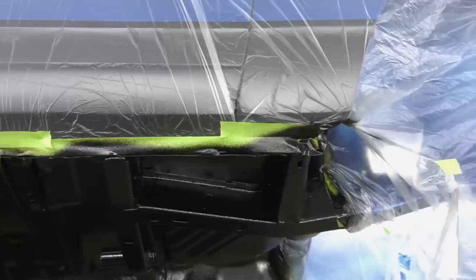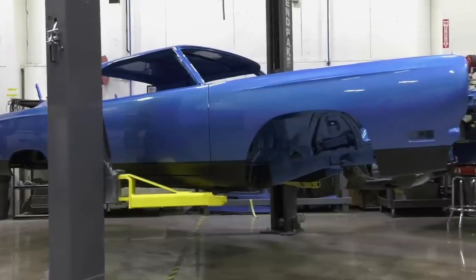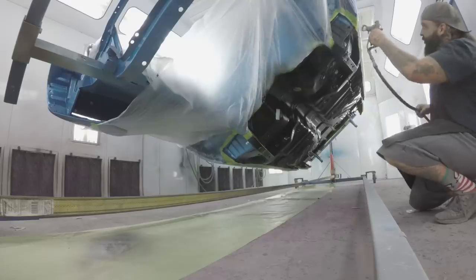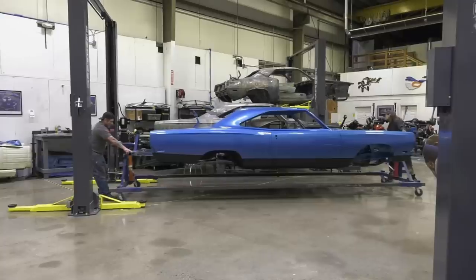The undercoating process we do on 90% of our cars depends on what the fender tag says. Once the car is completely buffed and all the paint work is done, take it out, pressure wash it, give it a really good bath, get all that compound out — because if it's left on there it gets hard as a rock. Get the car cleaned, bring it back into the paint booth, mask the whole car, and at that point I'll undercoat it. We have a great system — very easy, low maintenance. Smells horrible. Let that sit a couple days in the booth, then kick it over to assembly and take it off the whirly jig and throw it on a bin pack.